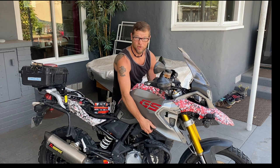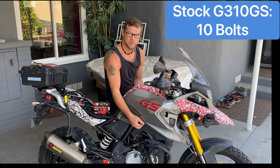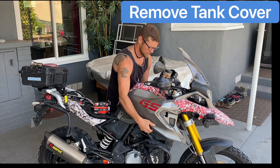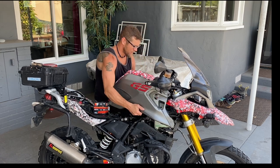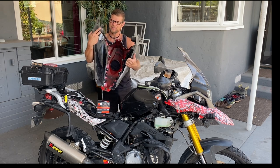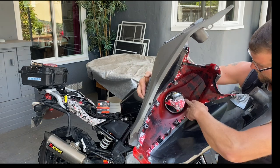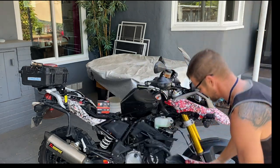Now that we've eliminated all the bolts — one rear tank bolt, two tank shroud bolts, and two bolts in the front — we can pull this piece apart. I pull it to the side and over in this direction because of these little insets around the tank. Also notice inside there are clips that go around the tank, which we need to focus on when we do the reinstall.